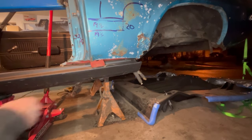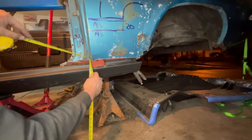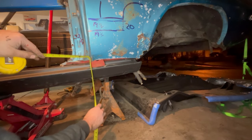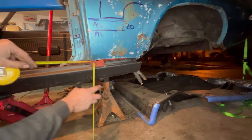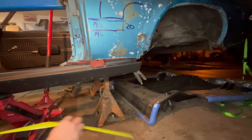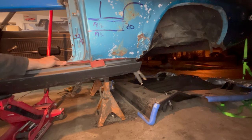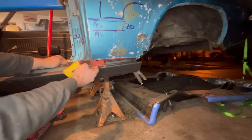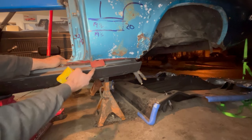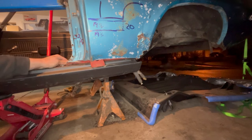As for the back, straight down from the door jamb should be 19 and a quarter. Let's see how we're faring up. Right there — 19 and a quarter at the peak, and the back corner should be at 20 inches. I'm not going to get any better than that. We're at the right height. Now the quarter panel has a little wiggle room here. I'm going to need to pull this in just a little bit and tighten it. I can't do anything with this brace because the quarter panel goes in between this piece and the rocker panel. I'll have to go to the inside of the inner structure, pull it in about an eighth inch, and then secure it.